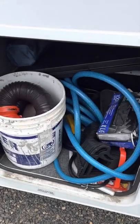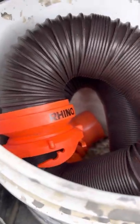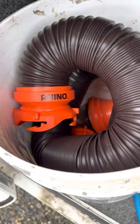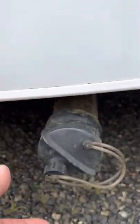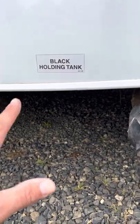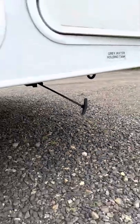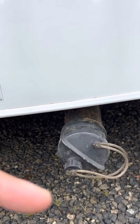Then you'll come to this cabinet — we have gloves for you to use. You'll get your sewer line, and you'll see at the bottom there is a plexi-style base; you want that to go into the compartment. This part right here is what connects to this, so you will take this off and connect that on there. Once you've done so, you're going to remain closed on your black tank, but you will open your gray tank, which will continually flow all the water and liquids except solids from the septic. Leave that closed when you're done or when you're full on your black, then pop open the black, which is this connection right here.